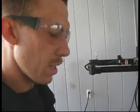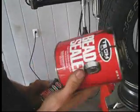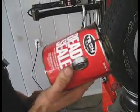that prepares the tire for the patch. And this is something extra I do. When I put the patch on, I put bead sealer too. And because of this, I've never had a comeback using bead sealer.